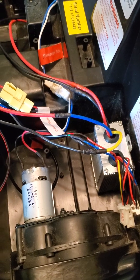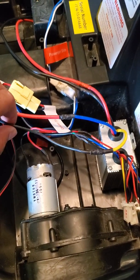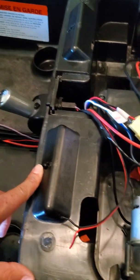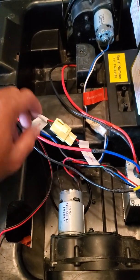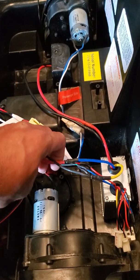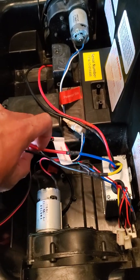Typically, if you're not doing any kind of brake setup, you can connect the positive and negative coming from your shifter. That's usually going to have a stock connector going to your battery — just clip that off and connect it to the wires coming out of the ESC. This is power going to the motors.